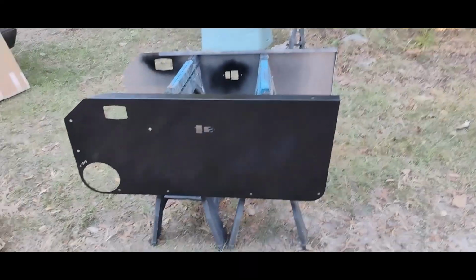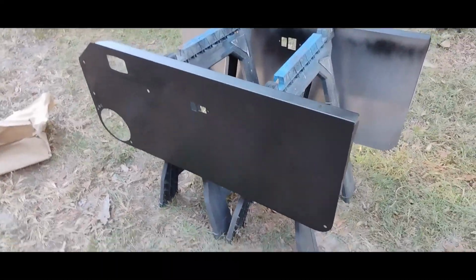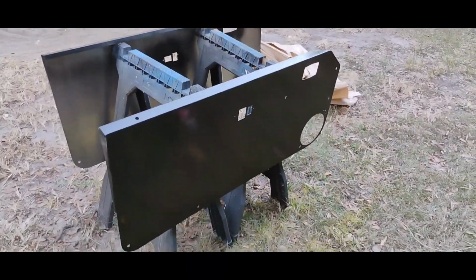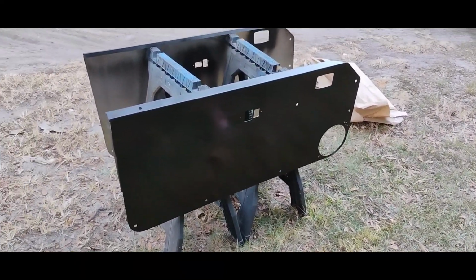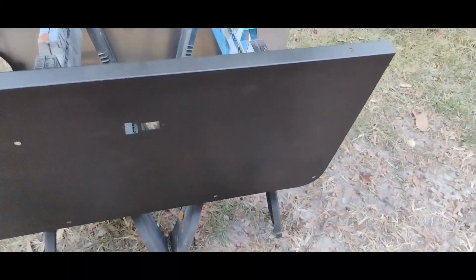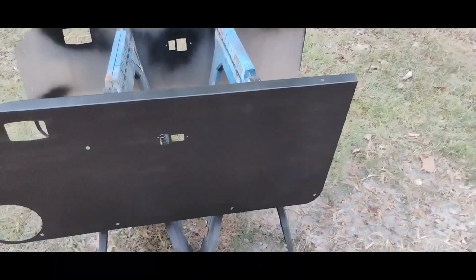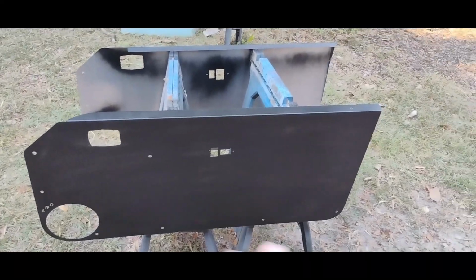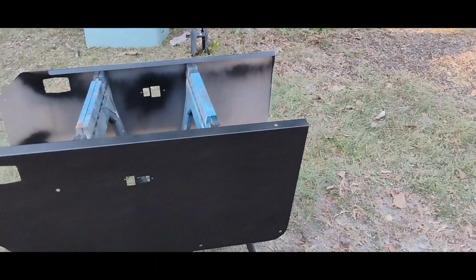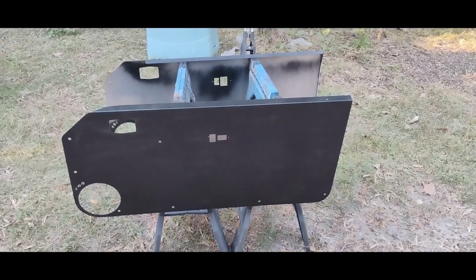But that's 1 coat. Well, minus the tack coat, so basically 2. You can see this is kind of dry, and you can see a little bit more of the striping in it. And this one just got done, so you can see it's reflective. One thing to remember, I'm not a professional spray painter at all, but light areas, don't worry about going back and touching them up. Then the next coat will cover it up. Each progressive coat covers up what was left behind. If you go back and find yourself trying to hit extra areas, sometimes you overdo it. So that's just my experience.